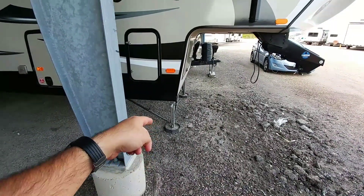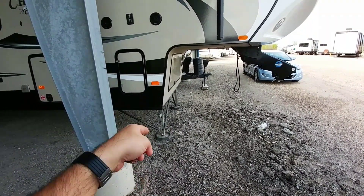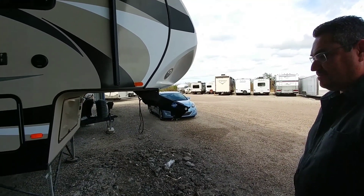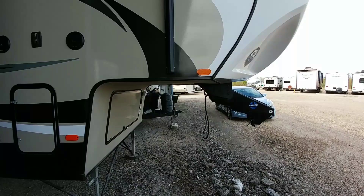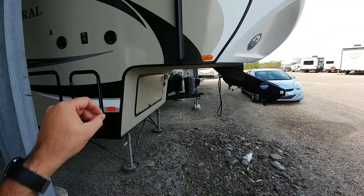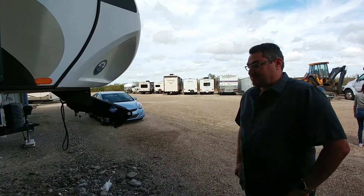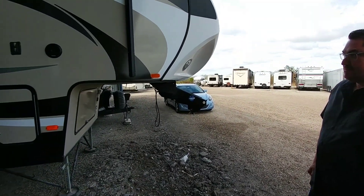I think you might get airbags in the future — that'll help with stability, especially the bounce whenever you go over bumps, and it'll level things out a little bit. We have the snap pads underneath your landing gear — those are made out of recycled tires, real thick rubber pads that just protect the feet when they're down. You got the JT Strong Arms right there — once you tighten them, they really stabilize the RV whenever you're inside, so they keep it from rocking around. The light under there wasn't working when we first came out, but there was a fuse that was loose in the fuse box — pushed it back in completely and the light came back on. We have the dual 10,000-pound dual-engine Bulldog landing gear, which replaced the 6,000-pound standard single-engine system that was on it when it came to us.